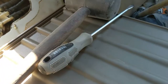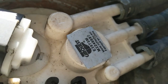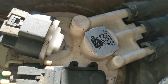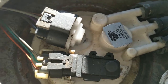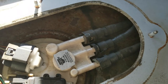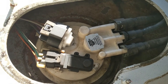Using a little hammer and flat tip screwdriver, blowing the dust off revealed a CarQuest pump. I'm not sure how old this one is, but it's not the OEM one so it has been replaced at some point. We'll be putting a Precision pump in from O'Reilly's. We've got two electrical connections on the left-hand side and three lines on the right-hand side — probably a supply, return, and vent would be my guess. I'm going to check my new pump to make sure our connections look correct before I pull this one out.